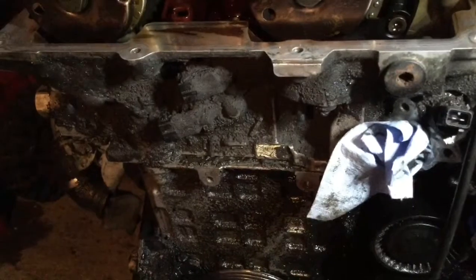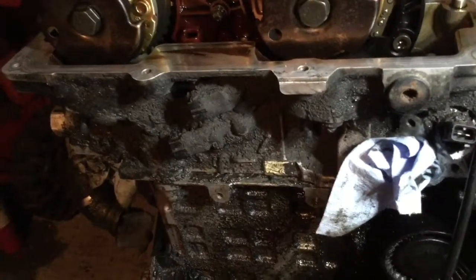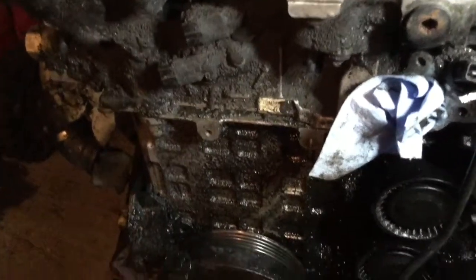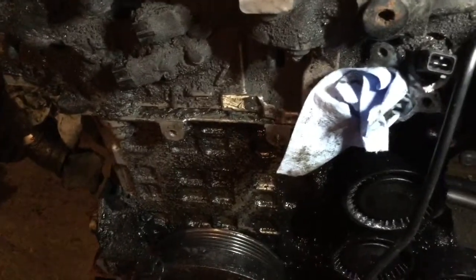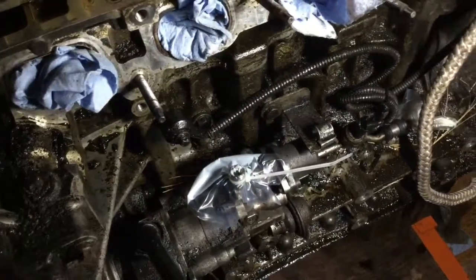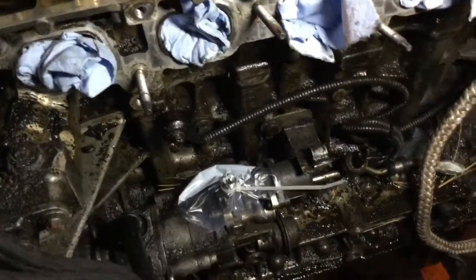What I'm going to do now is clean the cylinder head. I'm not intending to rebuild the head — I don't think it's going to be needed, but I'm going to check it. As for the engine block, I don't need to clean it much because I'm going to send it for oversizing and put new pistons in. They're going to clean it, so it's more a matter of taking everything off it. I'll need to disassemble everything on it, even the knock sensor. I'll put tape on them to know which one goes where, and there's a special procedure to reinstall those. I also need to remove the high pressure fuel pump.